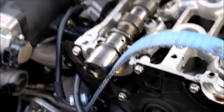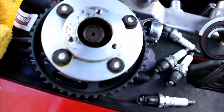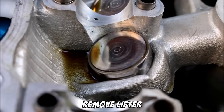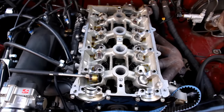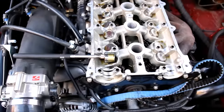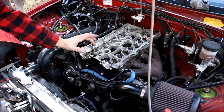On the VVT motor you do have to take the cam gear off to get the cam out. It's just three T25 bolts — be careful, they're very easy to strip. Once the plate comes off there's a 17mm bolt and the cam gear comes off. The lifters are now free to come out; I have solid lifters but early Miata engines had hydraulic lifters — the removal process is the same. Put the lifters back into the spot they came from. I'm doing one lifter at a time: remove it, do the seal, put it back, then move to the next.